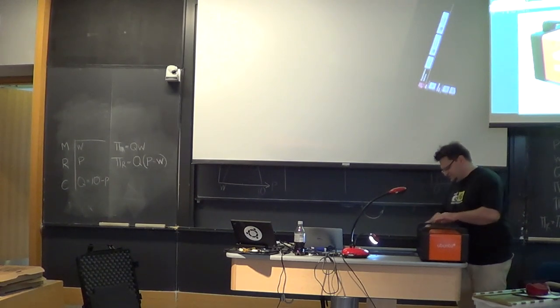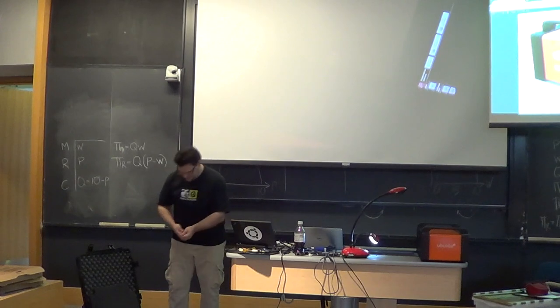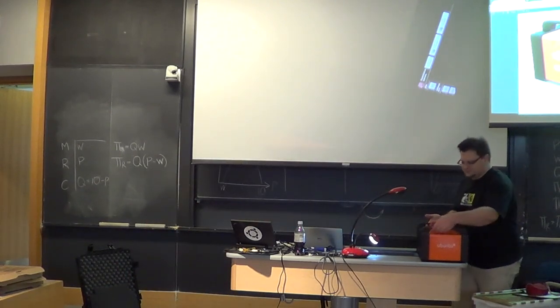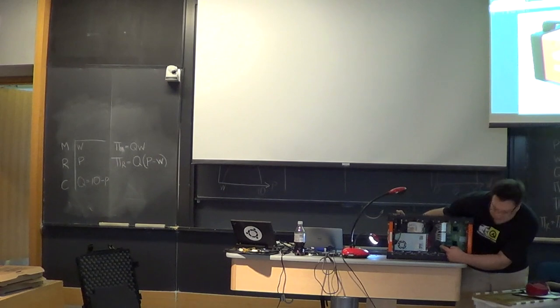Handles, as you can imagine, are necessary because of the weight, but there is another purpose to them, which is that when you're working on the innards of the device, it's really convenient that you can rest them on the handles. So I'm going to do that for the camera, but this is how it looks inside. Five nodes per side, plus the switch, plus the custom power supply that feeds everything. Four SSDs for extra storage for certain nodes, which are the storage tier.